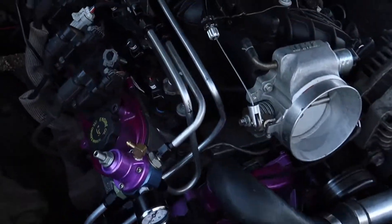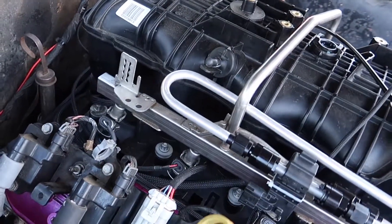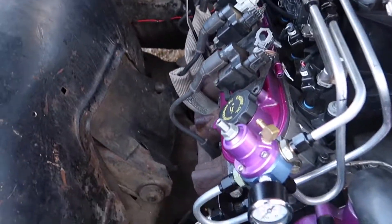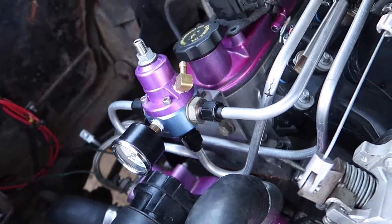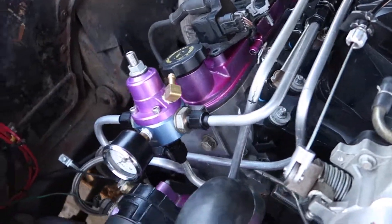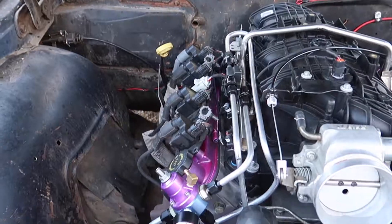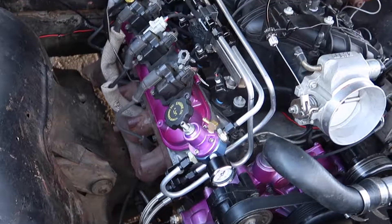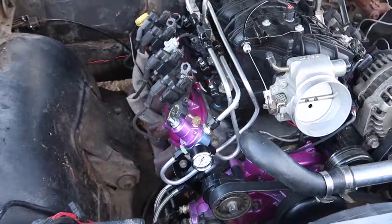Here's where we ended up with the hard line. It just makes a 180, goes down and around — it kind of looks like a pretzel, but it's really not that bad. Out the bottom, into the content sensor, makes this loop around, back down, and then over to the bulkhead, back to the tank. I'm going to cycle the key so it pumps the fuel, make sure we've got no leaks, and then maybe just try to start it up and let it idle for a minute so it'll consistently pump and I can double-check it.